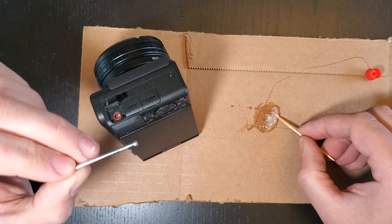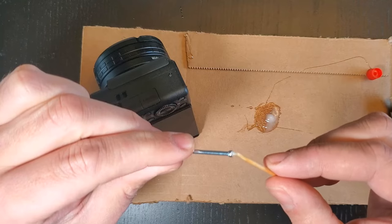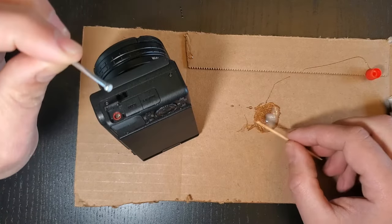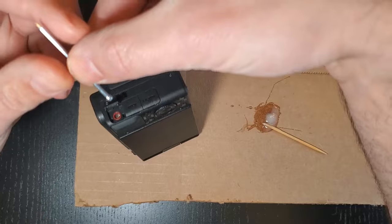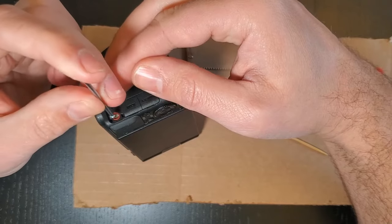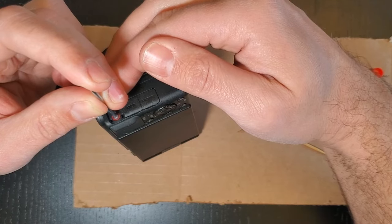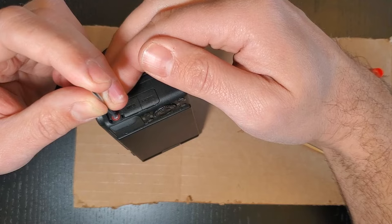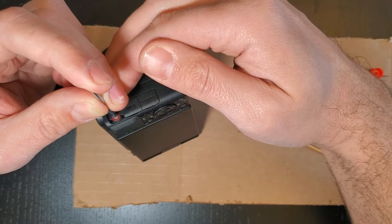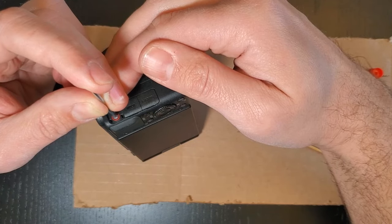It has been about a minute. Now we don't need a whole lot — you don't want to put too much on the nail head where it'll drip down into your camera. We're just going to put a little bit on the end. I hate using my phone for my videos because it doesn't focus worth a darn, but once I get my microphone fixed we'll be back using this camera. So now you're just going to place it on top of the broken port and hold on to it for about one to two minutes until it starts to set. Then let it sit for about one hour, preferably 24 hours if you really want to make sure it works, but an hour is usually all it takes. Definitely hold the nail on for at least two minutes.